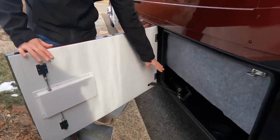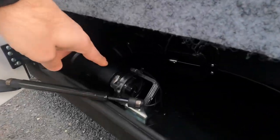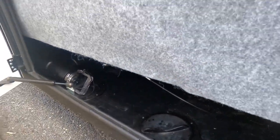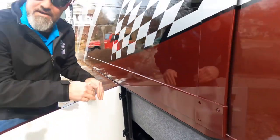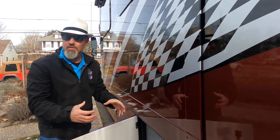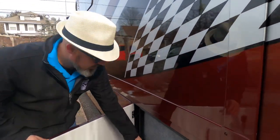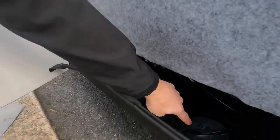Here's where you dump the black tank — hook your hose on here. There's a spin-out below, and the reason they do that is because when you remove the hose cover, any fluid in your sewer pipe will drip onto the ground instead of into the compartment. Hook your hose on and route it out and down through there.